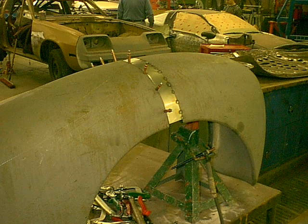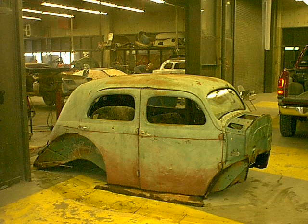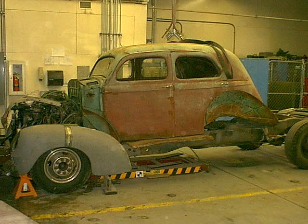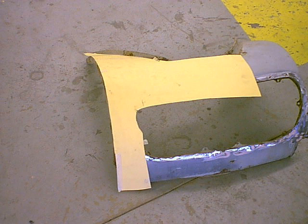Here's the other fender getting clicoed together and welded up. Here's a look at the body — it was a 1937 four-door sedan body that I had. What I'm going to do is lift this up and put it on the chassis and mock things up to see what I'm going to have to do. I decided I'm going to have to widen everything, including the front nose section, and I'm going to have to cut the car in half and widen it.